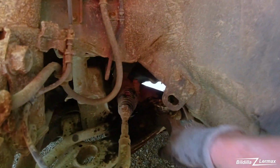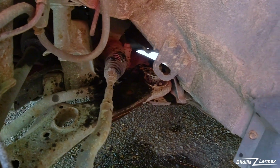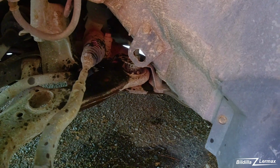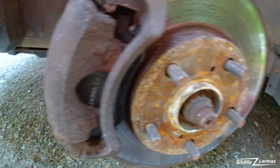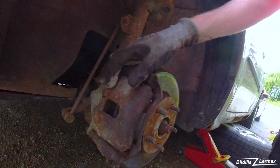You see, here coming some wet. The brake fluid reservoir on the top was leaking. Or there is too much brake fluid going back, so it's coming out here. Draining out to the ground. That was, yeah, unfortunate. Okay, but that's because I pressed this master cylinder so far back that it had to overflow. I wasn't thinking about it fast enough. Maybe I should have tried to take something out, but I didn't.